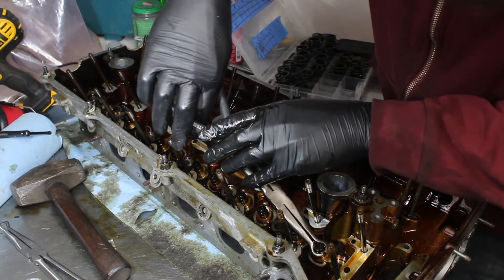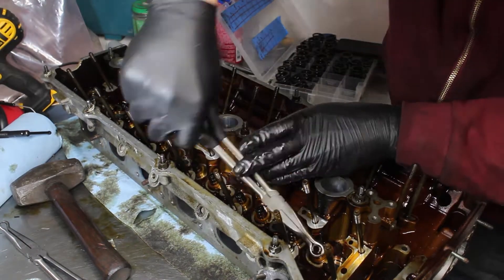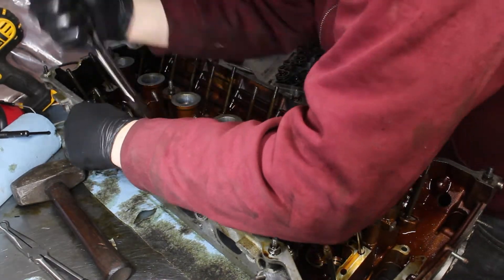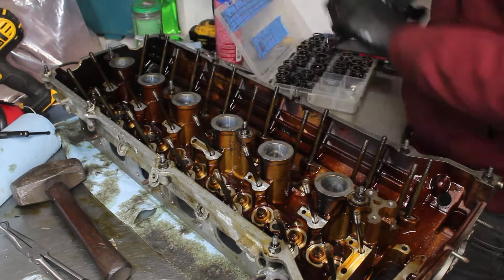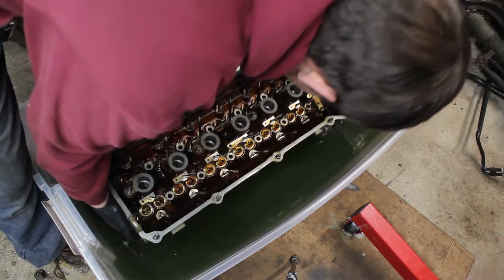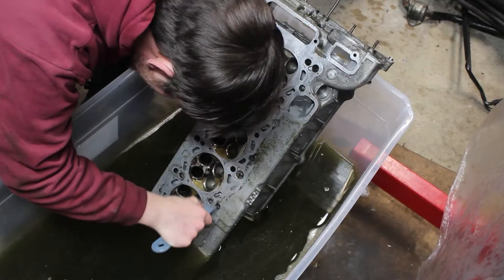This time I bought some hose pliers for getting the valve seals out. This worked far better than the vice grips and, more importantly, it didn't bend any of my valve guides. The spark plugs were still in the engine, so those came out too. I repeated the whole washing process, this time letting it soak before scrubbing off the old head gasket material, which made it much easier. Despite how the head looked, it actually cleaned up more easily than the original.